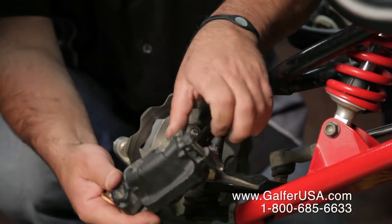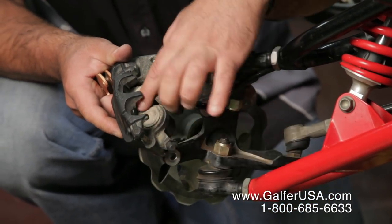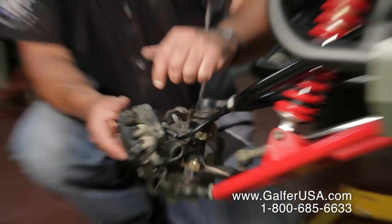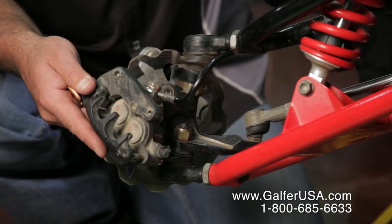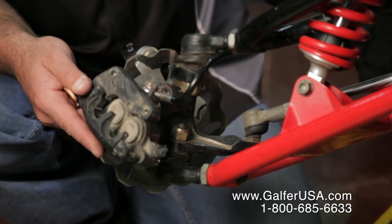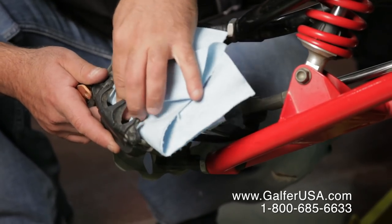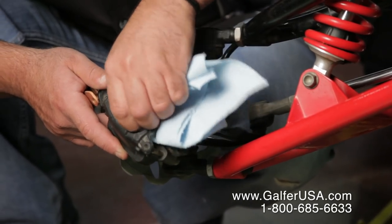This is always a good time before replacing the brake pads to look at your caliper and see if it's dirty. If it's very dirty on the surface, the bleeder, or the pistons themselves are dirty, we usually suggest getting some brake cleaner and spraying it on the pistons. You can also push the pistons out a little bit by squeezing on your brake lever. That will show you more of the piston itself and all the grime the piston is hiding. Once you've pushed that up, a little bit of brake cleaner on a towel and just try to clean the pistons as best as you can. If you have an old toothbrush, you can also do the exact same thing around the pistons themselves.